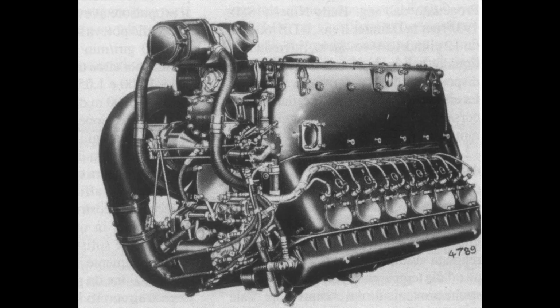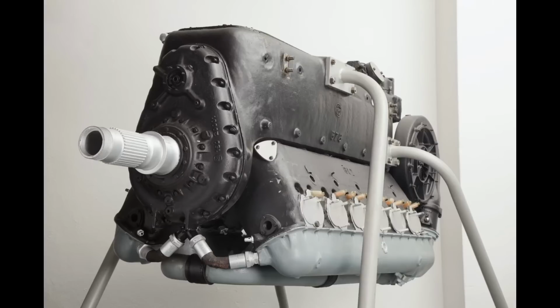It is also interesting how the fuel sucked from the tank was first filtered and then deprived of the air bubbles in it. Having these was indeed very dangerous in an engine with injection, because it stops forming an irregular mixture. The individual elements of an injection pump must introduce a well-defined quantity of fuel, which must correspond to the power to be obtained. The pressure under which the injection takes place inside the cylinder is so high that the small quantity of fuel is finely atomized, forming a flammable mixture with the air which is introduced at the same time.